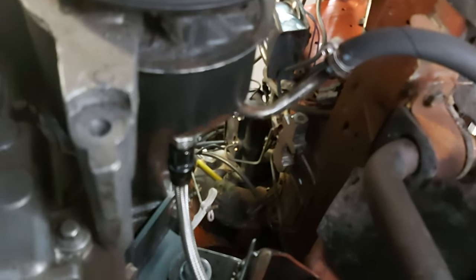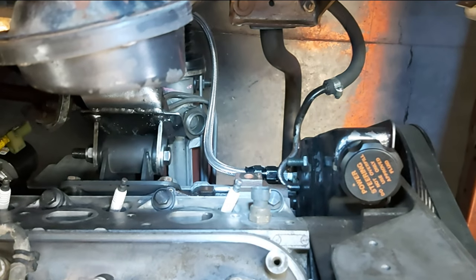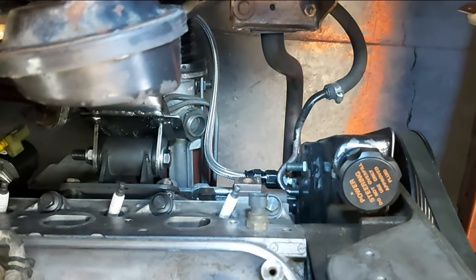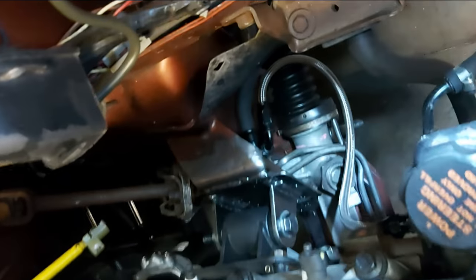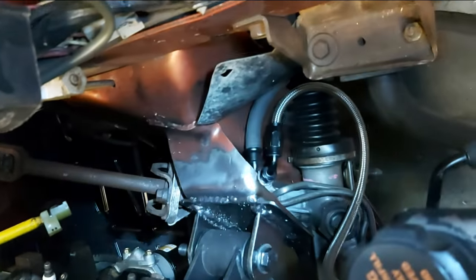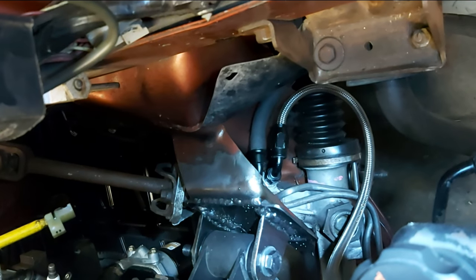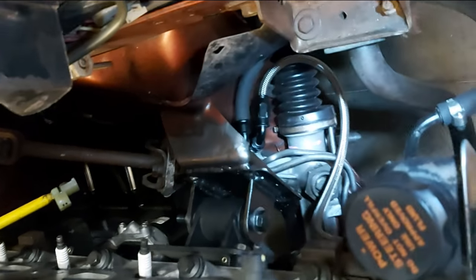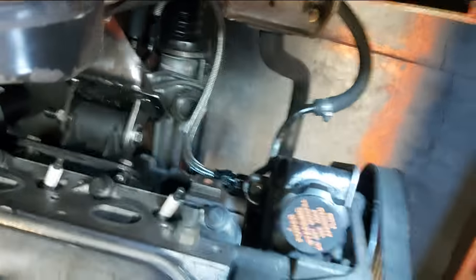So that's the Turbo LS power steering pump to rack install. I've already reduced the pressure with a pressure reducing modification on the valve inside that power steering pump — that's the scene you've already seen, so now this is the finished product. Just a quick view from the top guys — that's the factory LS power steering pump. Here's our pressure line going to our rack. The braided one is pressure and the black rubber one is the return. Hopefully it doesn't leak, and if it does we'll just get a different rack with the proper threads.